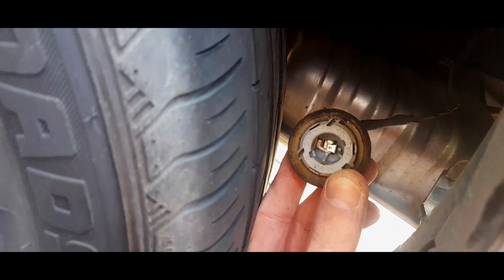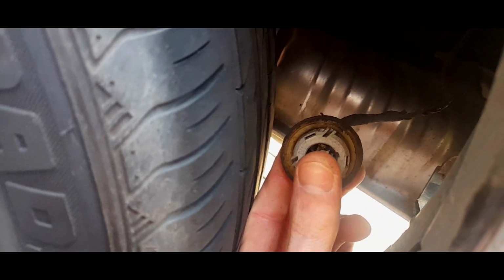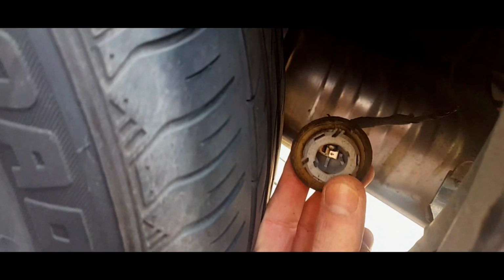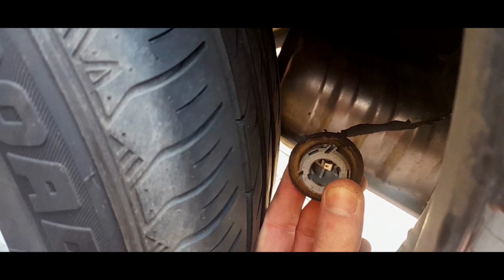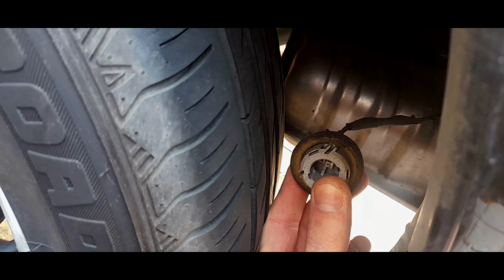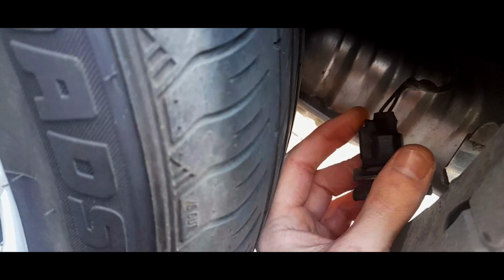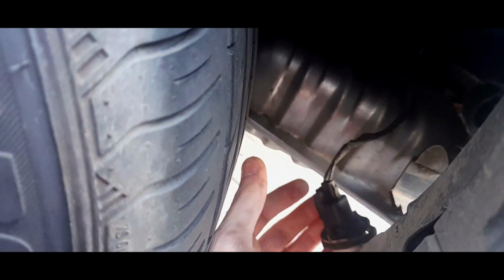But what I would do is get some contact cleaner and a fiberglass pen to clean all the green corrosion away. If it's so bad that it still doesn't work after cleaning, you need a new one. As I say, I'll put the part number in the description. You'll just need to take off that electrical connector by pushing this tab in. Obviously you're going to need two hands, but you're just pushing this tab in, as most of the tabs are. It's never this wiring. I've never known this wiring to break.